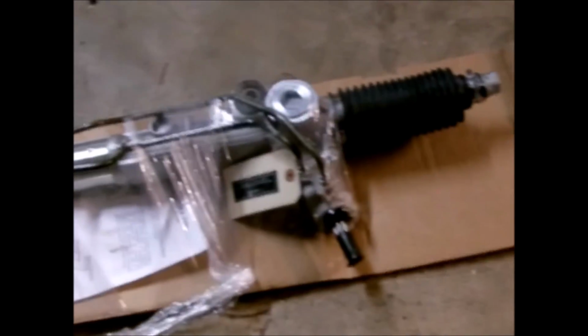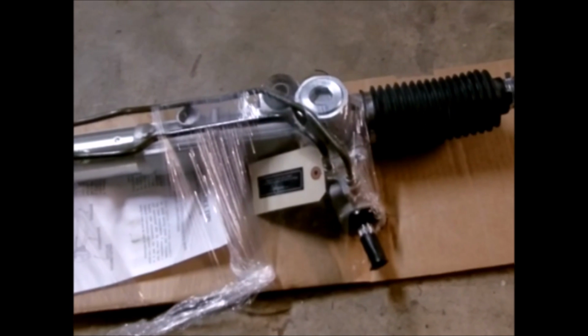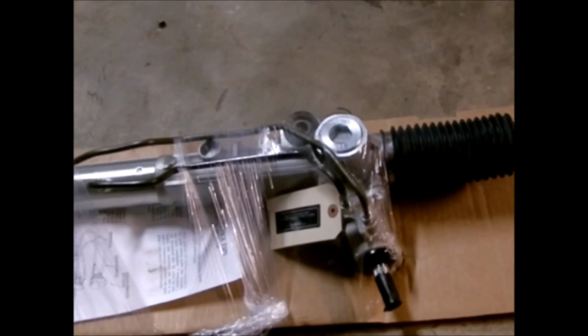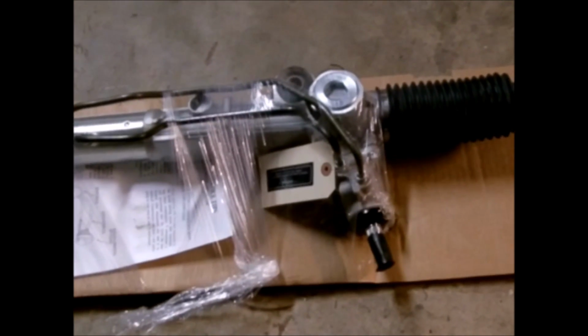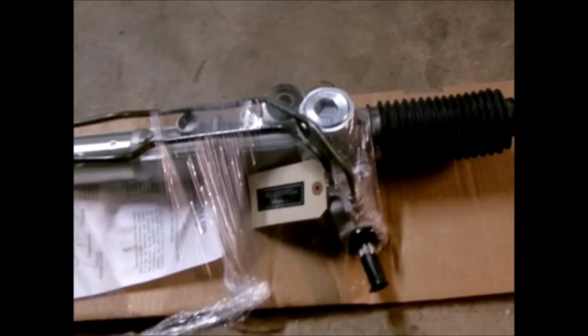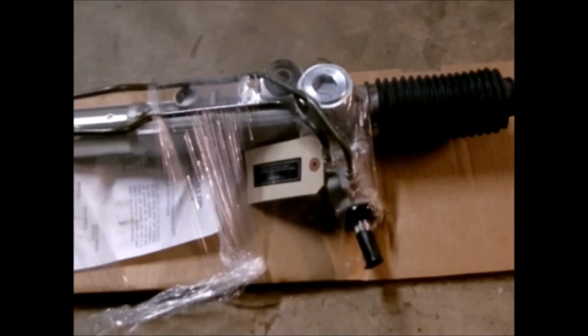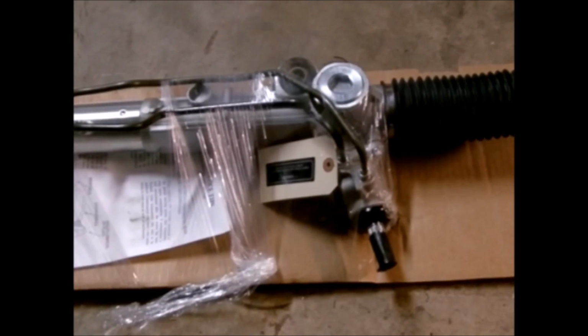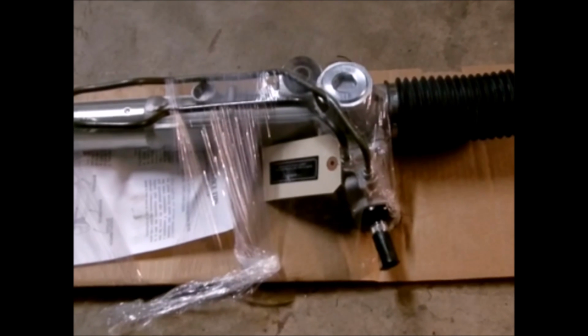So that way you're not turning the steering wheel a whole lot, because on the horn assembly, I think it's a clock spring that allows you to turn it as much as you want and it won't hurt it. But where this vehicle has airbags, there's a possibility that, the way the wires are run up through there, if you turn the steering wheel a whole lot, it could possibly twist those wires up or break them or damage them.